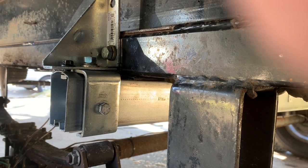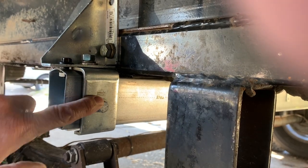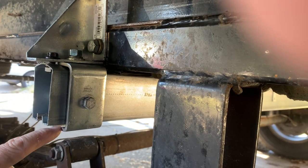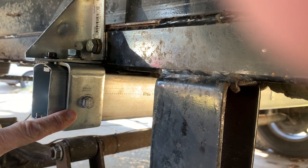Okay, we're finished with the job. The fresh water tank is now supported very well, so let's take a look at how I took care of the business here. Here we are under the trailer. I've got the box rail installed here, and I used the bracketing. I added this bolt so that it's not just sitting on these little arms — I put a bolt all the way through the box rail and the bracket.